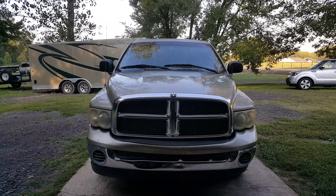We're back working on this 2002 Ram 1500. Today we're going to be replacing the rack and pinion — this is a two-wheel drive. We're also going to be taking care of the outer tie rods and inner tie rods, which come with the rack, so that's going to fix a lot of the slack we have in the steering.